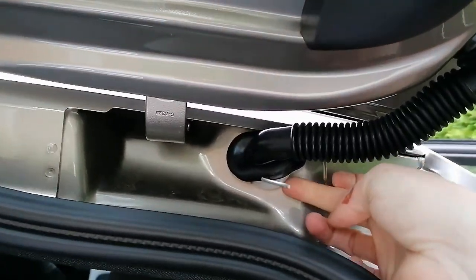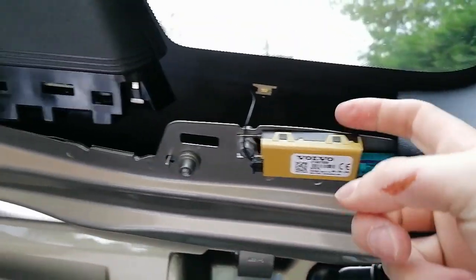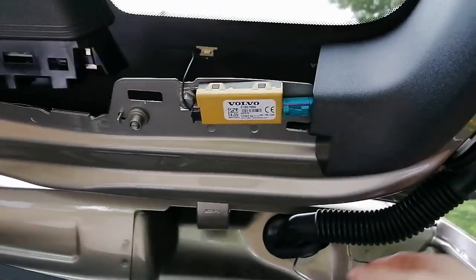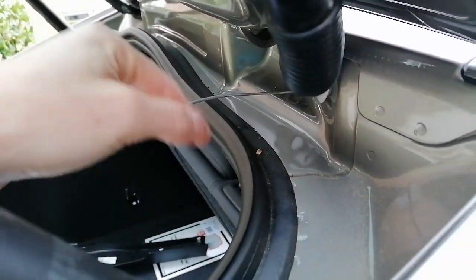have the cables come out of here, pass into this plastic thing and go inside. So I remove the panel here so that the cable is nicely tucked into there. So I took basically a cloth hanger and I managed to pry a little bit here, pass it on, and actually it was at the first attempt, which I had not expected. I'll have to take care, make sure that there's no problem here with the airbag and passing it on top.